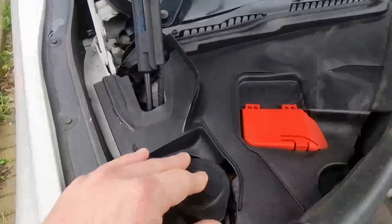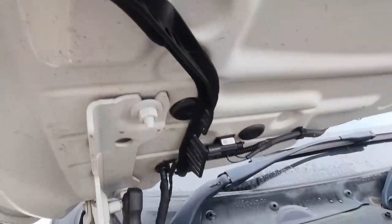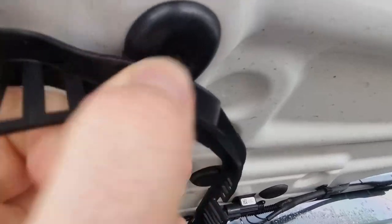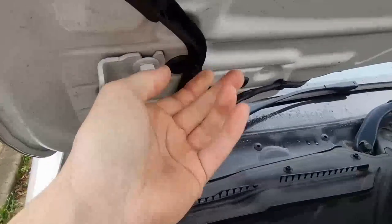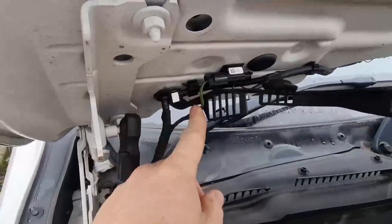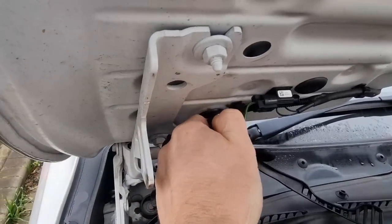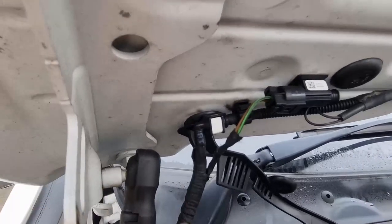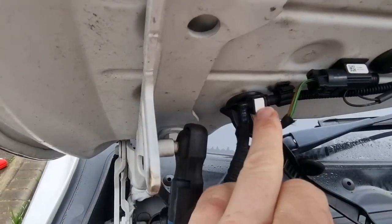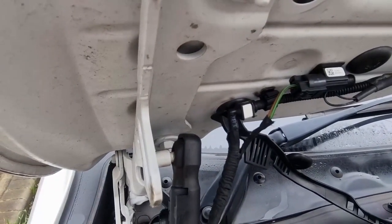So the emergency quick fix is blowing back the pipes to blow the gunk off the filters. What you need to do is lift the bonnet, open up the reservoir filler cap, and pop these down. These just pop off the little suction pads there, and what you have is a little join here. You can push in the white bit — basically where you've got the pipe and the white clip, push the white clip in and that'll pull the pipe out.